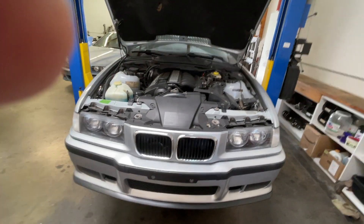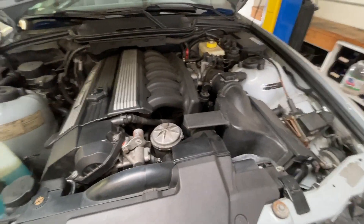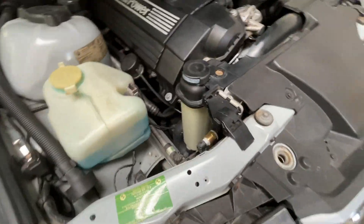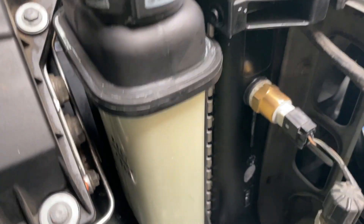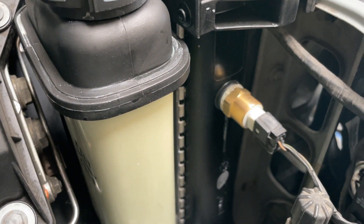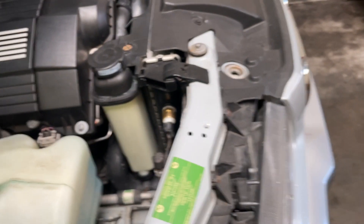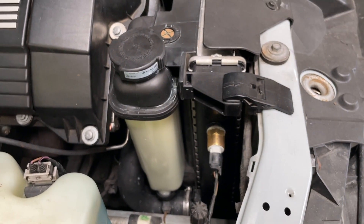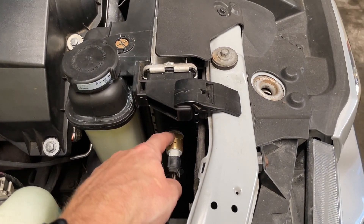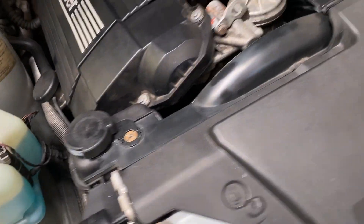Happy Friday! The M3 has been low on coolant a couple of times and this little sensor over here has been dripping a touch. I keep tightening it — tightened it to spec, then it went down another pound, then another pound, so I just keep doing quarter turns. It's a new radiator, new sensor, clean threads, no separate gasket or washer — it's that built-in crush washer thing — so hopefully that fixes it.